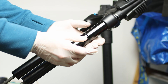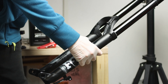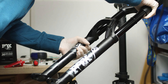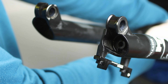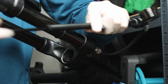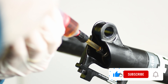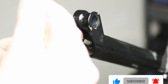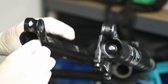Place the new side o-ring on the air extension, then insert back the lower legs onto the extensions. If you push the lower legs all the way in, remember to pull them back a little so that you will be able to insert the oil. As Fox suggests, pump the fork to your desired pressure. On the air side insert 10 ml of Fox 20WT gold, and on the damper side insert 40 ml of Fox 5WT. You can now push down the lower legs completely.